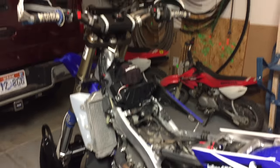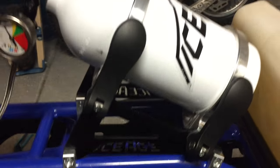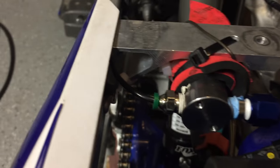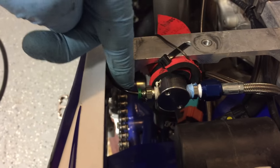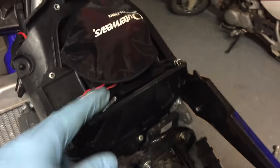Before I put my gas tank and everything back on, I just want to show my nitrous setup. Down here you got the nitrous bottle, the clamps, everything holding it on. I ran my hose right up through here. Over to the right side I see a zip tie that I need to clip off. It comes up through there by the muffler and comes over and it's sitting right here at the solenoid. From the solenoid, you got wires coming out the back and you got your little nitrous tube — the most important tube on the bike.